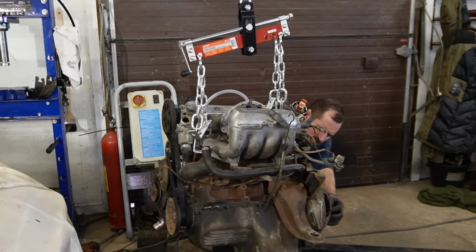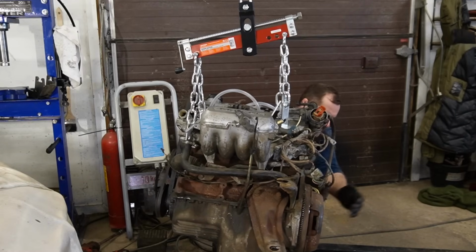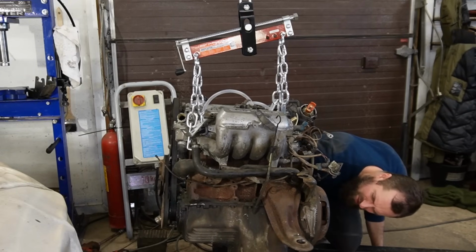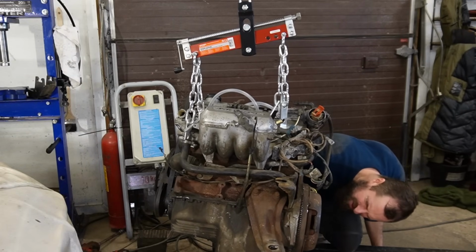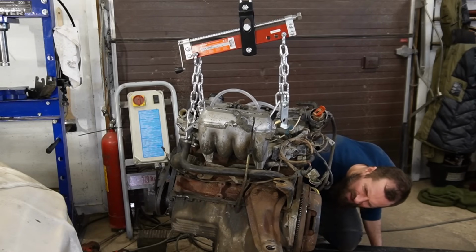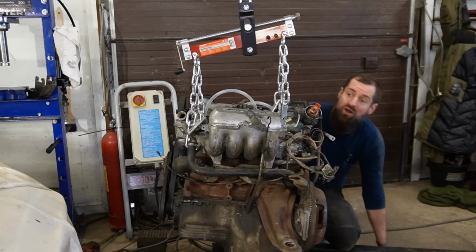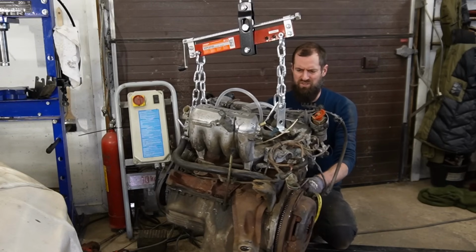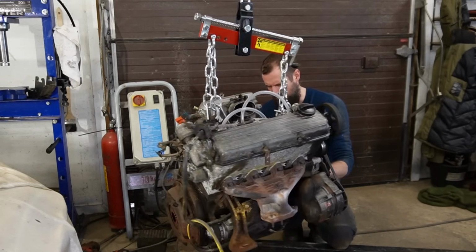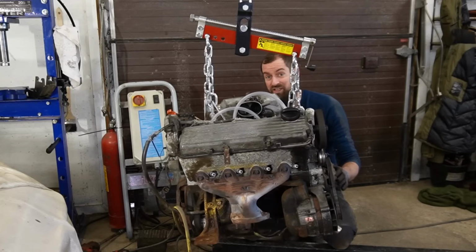The clutch plate is slightly damaged from the dragging release bearing. So I'm just going to go ahead and change it all, I think. Maybe not. I have to take a look at that clutch before deciding. There's a damaged torque spring. I might just change it. I have bought a clutch, but I can return it if I don't have to use it. But I do need to change the throwout bearing, of course. And then I need to fix the oil leaks. Yeah, but that will be in the next video.